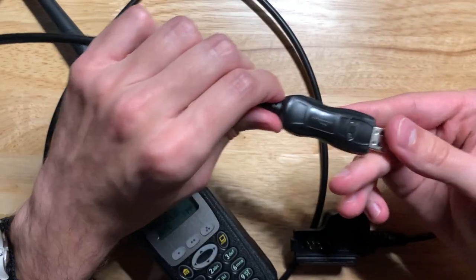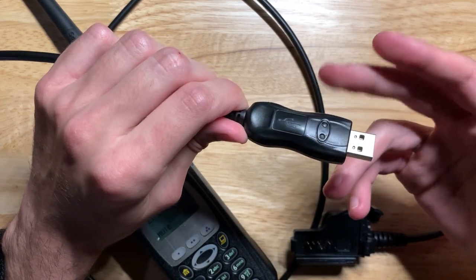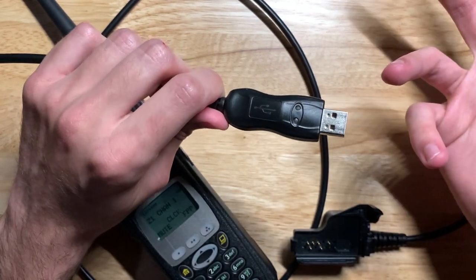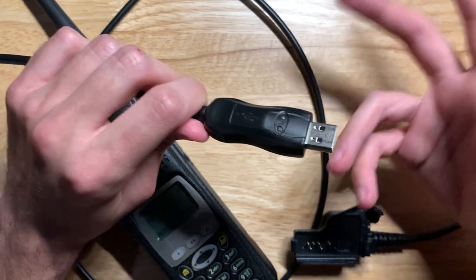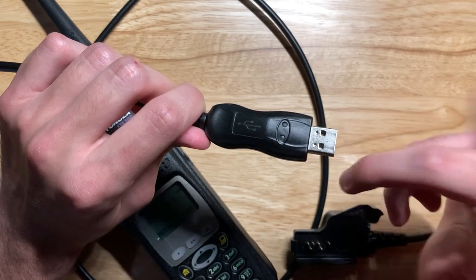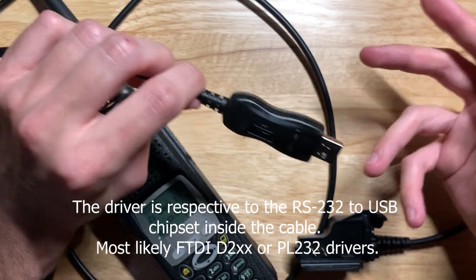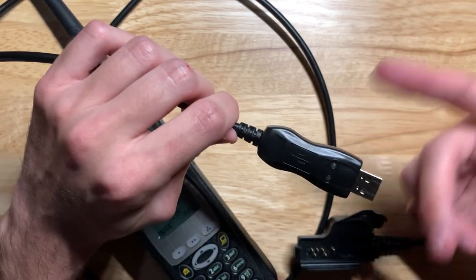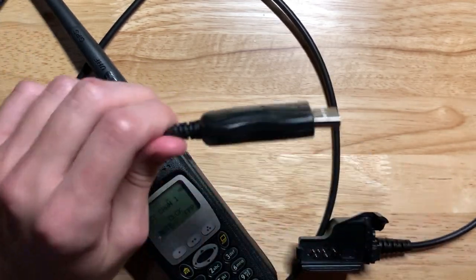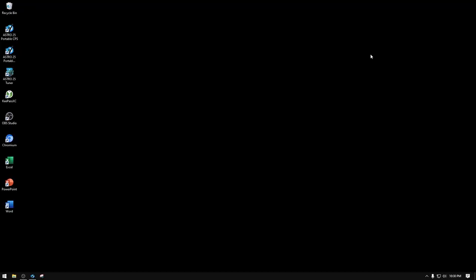And these actually require drivers. So if you buy one of these, and I'll have a link down in the description below again, the computer needs to install a driver. Now, if you're using this on a computer that never touches the internet, like a secure machine, you need to install the drivers manually, because Windows will not pick that up. But if the computer's connected to the internet, you should have no problems running this out of the box. You don't even need an installation disk to install the driver or anything like that. It should be automatic, so not to worry about that. So I'm going to go ahead and plug in the USB cable.